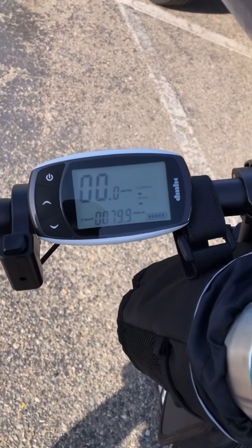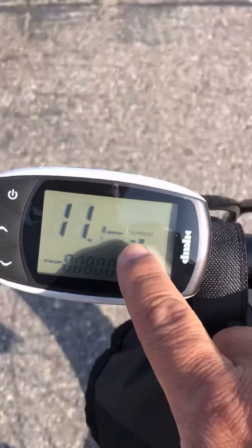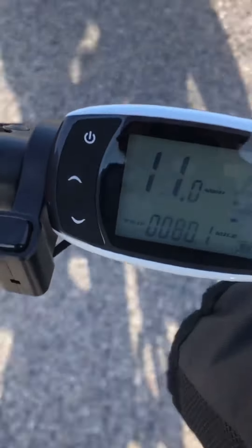Okay, we're now at part B of the long distance road test for the Jupiter Defiant. The objective today is to ride around 30 miles using either pedal assist mode 1 or 2, and see what kind of battery draw we get out of those lower modes — and whether we can sustainably get 30 miles or run into issues. We're starting with our mileage at 79.9. As we're going, it's only drawing about 2 to 3 amps of current. If I pedal hard, or if I stop and re-engage, the initial startup draws 4 or 5 amps and then it slows down into a pretty steady state.